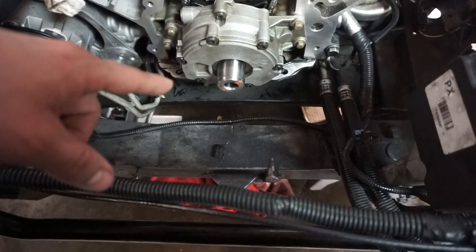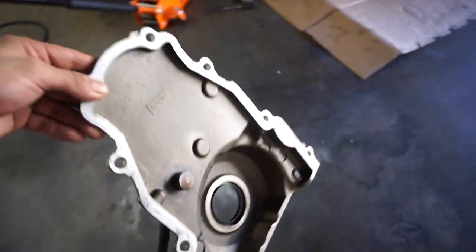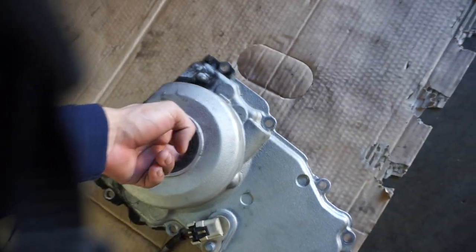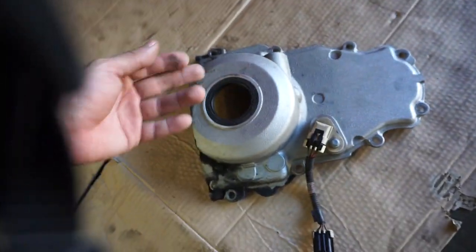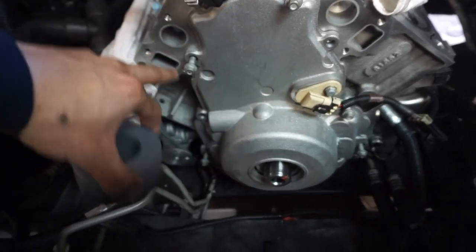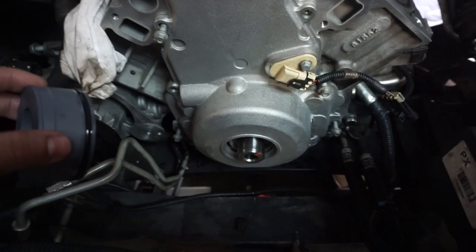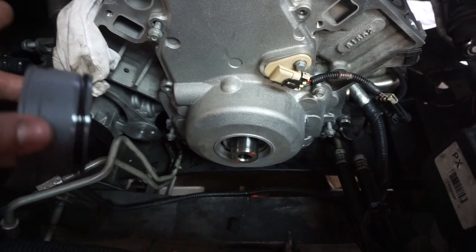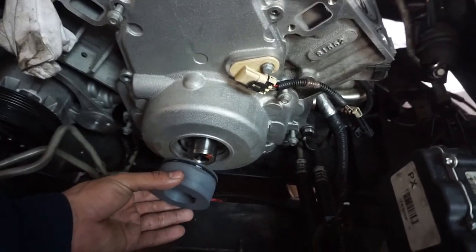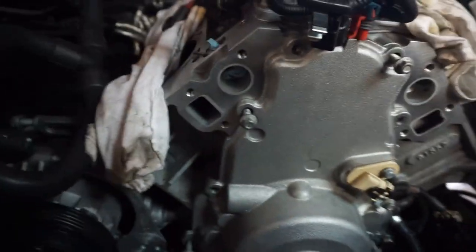So we've got to clean up this timing cover, get that old seal out, replace it with the new seal, and use the front main seal tool that I got. LS timing covers are free-floating — there's no dowel pin or secure method for it to sit perfectly. That's why a lot of times when you put this on you just eyeball it and will have a leak somewhere because it's not fully seated. This is where the Sac City Corvette alignment tool comes into play and is very handy. Pretty much lube up the O-ring, slide it in, and you should be able to get it to line up perfectly. There you go.